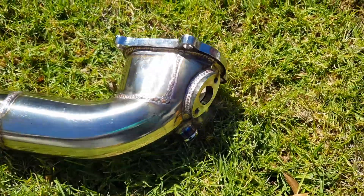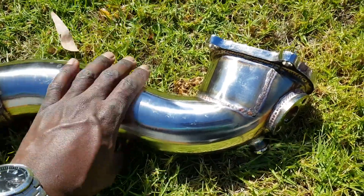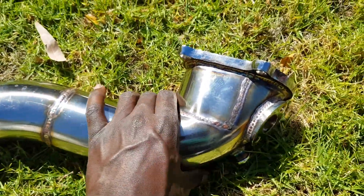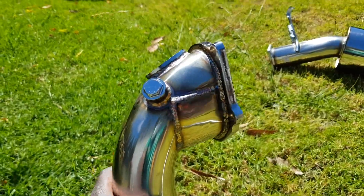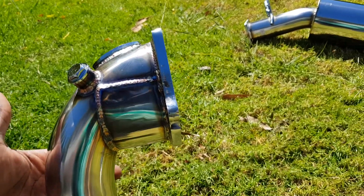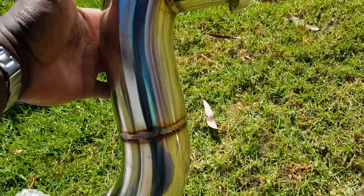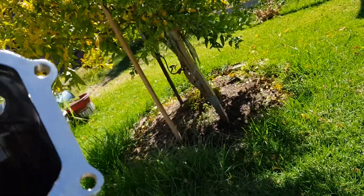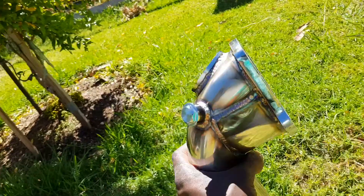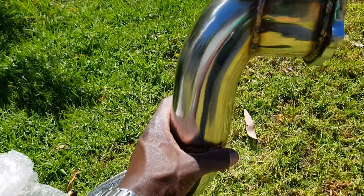This will be better than the stock one, but it's almost three inch — it's not quite three inch, it's about two and three quarters when I measured it. So I was actually very disappointed. I thought they were going to give me a three-inch downpipe all the way through, but they've actually made it smaller. Now I'm going to have to find a three-inch downpipe to match.